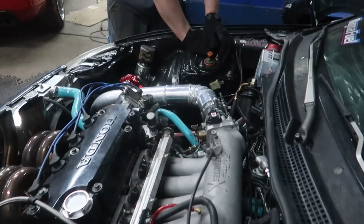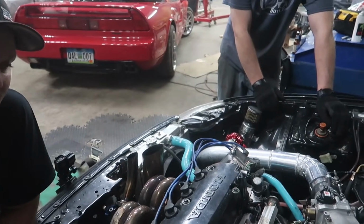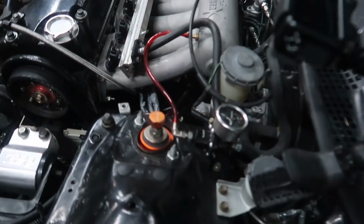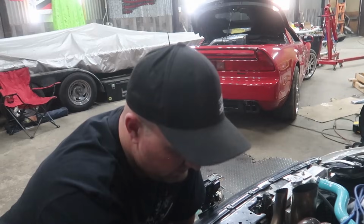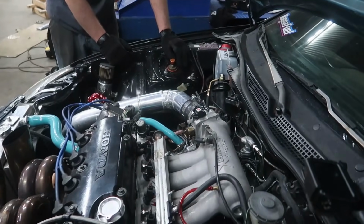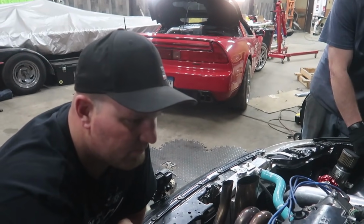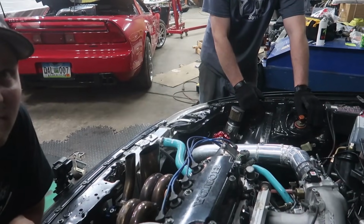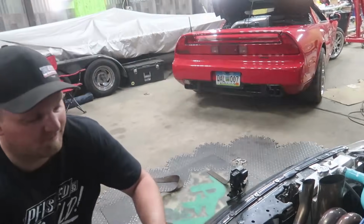And we saw 70. That's 15 off. So that's not one-to-one. That's why we don't have enough fuel. Yeah, so it could be this regulator itself. Or the injectors are smaller than he knows. But like you said, they say FIC 70. And the fuel pressure itself shows that it's not one-to-one-ing. So if that doesn't one-to-one, it doesn't matter what the size of the injector is. You know what I mean? It has to one-to-one to get the right ratio. Yeah. To get the multiply. Yeah.